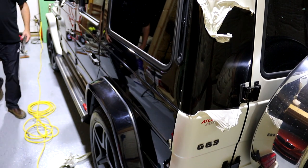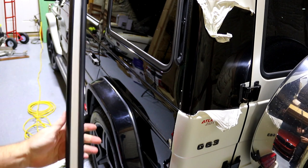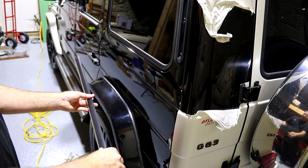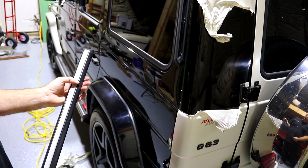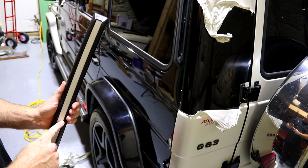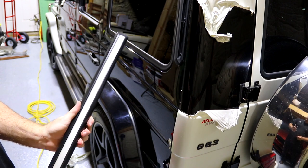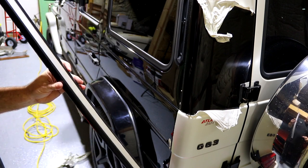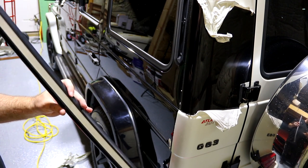All this side molding was taken off and put back on, and it was a mess. These pieces go on the sides — somebody took them off and bent them. The rubber is fine and we could straighten it, but a lot of these actually kinked the aluminum insert. The rubber piece peels off, so even though the insert isn't usable, the rubber still is. They make a different insert — a carbon black or piano black one. I ordered the carbon black version so it's black carbon fiber but barely noticeable.